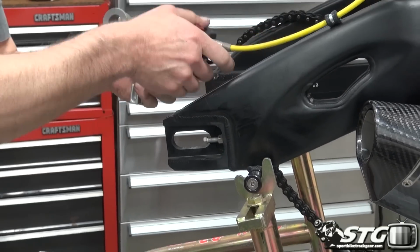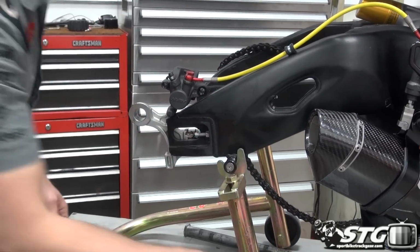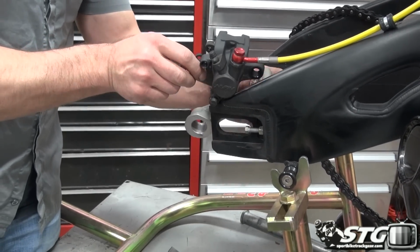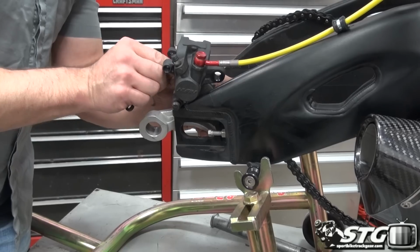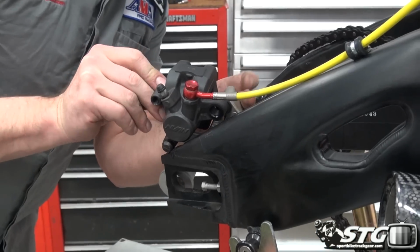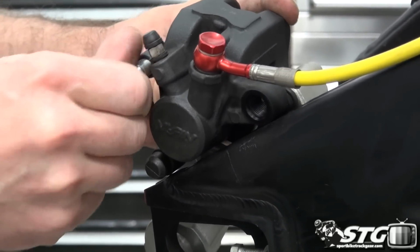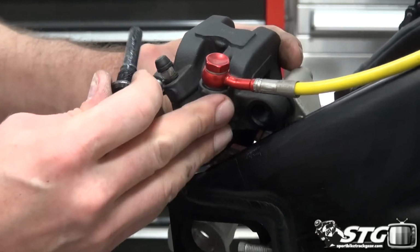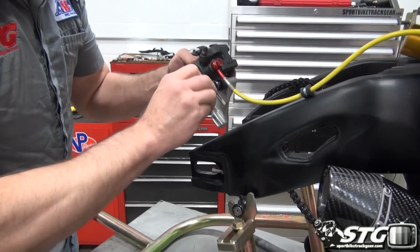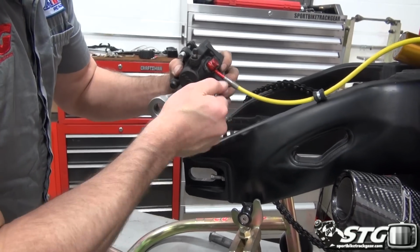Now, we are ready to begin with the assembly. So get our brake pads here. Slide the brake pads up into position. Groove, slide that pin in through there. You want to inspect that pin for grooves or wear, anything that the brake pad could hang up on when it's trying to slide back and forth. Because if that is binding at all, okay, and the brakes are binding, you are essentially giving away 3 horsepower because it now becomes harder for it to rotate the rear wheel.